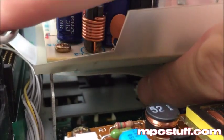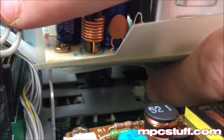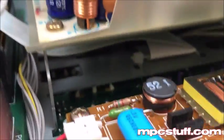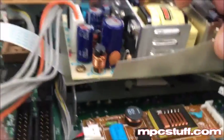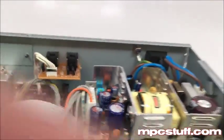As you can see in here, that's the zip tie that's holding this in. So if you can get at it and cut that zip tie off with a scissor — see where we are right here? This is the inverter here, this is underneath that power supply part. Kind of zoom out so you can see where I'm working. If you can cut that off, it's going to make it easier for you to pull that out.